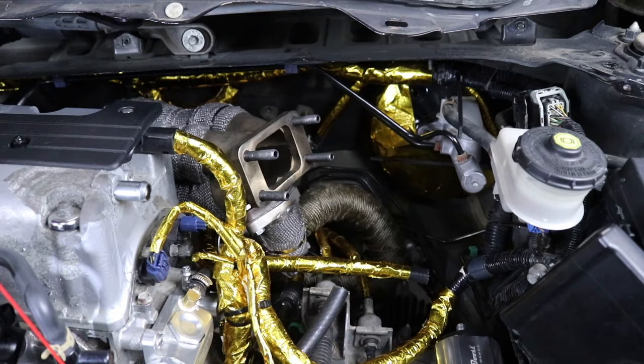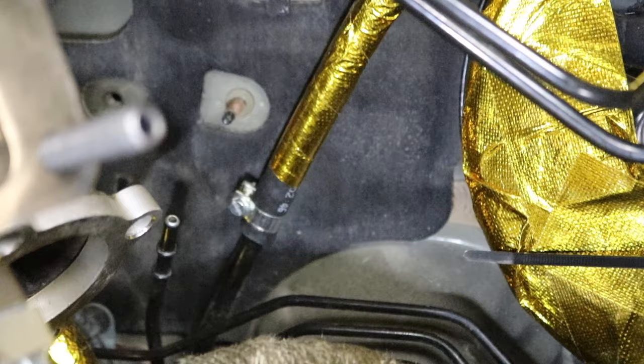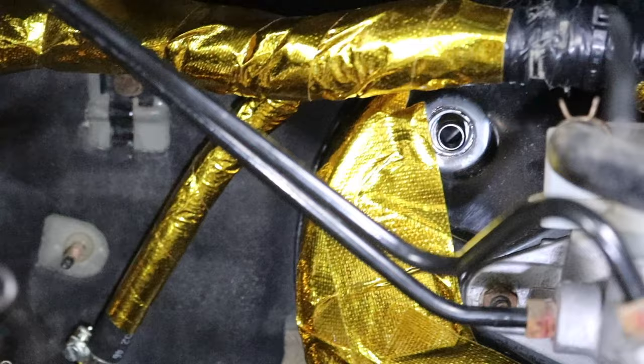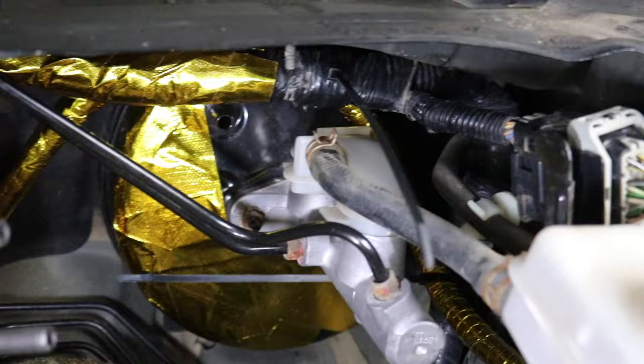The upper hose runs under the manifold right to the back of the upper coolant housing — gold heat taped. On the lower heater hose, I actually used the factory one and just flipped it and it bends perfectly over to the black heater hose without hitting the wastegate lines or anything. So we only needed to build one 5/8 hose; the other we were able to use the factory one. Then you can see right back in there, we got our purge line built — also gold heat taped. I got a little fuel line hose clamp on there just to make sure it doesn't come off. It routes up above the brake master cylinder and I zip tied it to the engine harness.